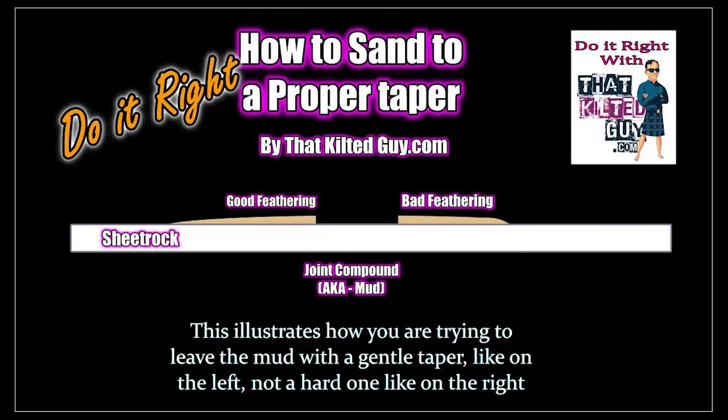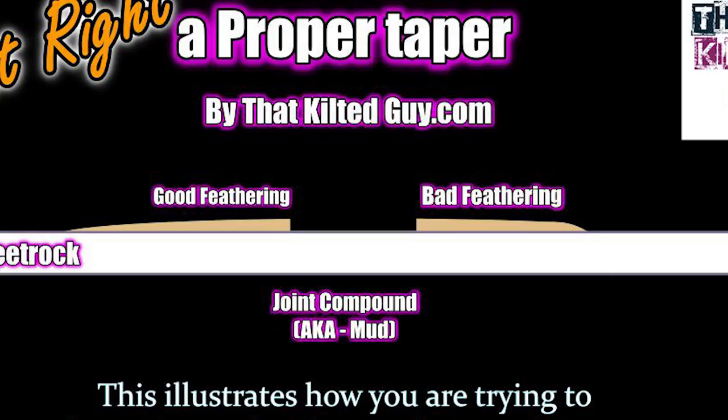My final pointer is how you sand it. When you sand it, you're just trying to sand it to a gentle round hump. But the edges are real important — if you don't feather the outside edges, that can give you away also. Let's look at that bad repair again. If we zoom in on this and you look at that left edge, you'll see how it's not feathered out right — it's rounded like I showed in that illustration. So that's where the shadow is most prominent, and that's giving away that edge really badly.